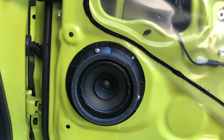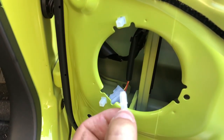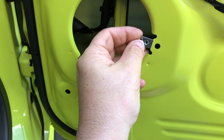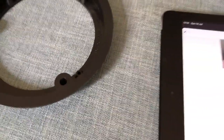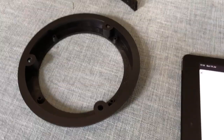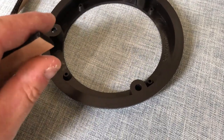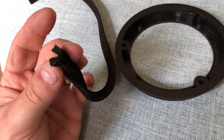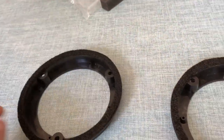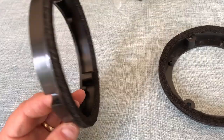We're now going to remove the standard fit speakers. We also need to remove the three white plastic clips that were holding the existing speakers — they work like rawl plugs. The next thing is to fit the metal clips onto the holes for mounting the new speaker; they just slide into place. I've come inside for the next bit, which is to apply some foam around the inner edge of the new speaker mount to insulate it from the metal of the door. We're going to use the thicker piece of foam supplied in the kit — it splits into two down the middle, so we use half for each side.